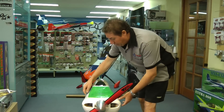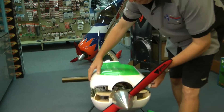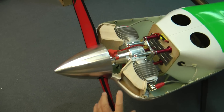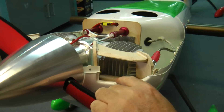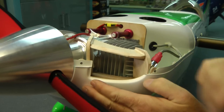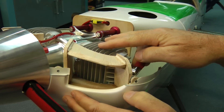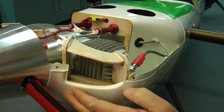I'll get Mark to come down and have a look — we'll take the lid off this H540 and you can see what I've done on this one. Now it can be as complicated or as simple as you really want to make it. As you can see, this one's been made of balsa and it's got some light ply over it — just half millimeter ply that's been CA'd onto it. Essentially what I'm trying to do here is channel every bit of air going in through the front onto the cylinder fins. These are the things that are going to do all the cooling for you, and if you can get that as direct as possible onto there, the better it is.